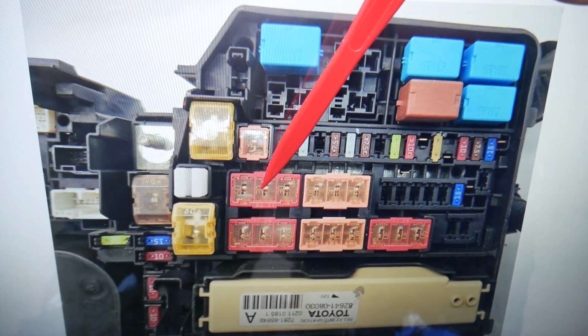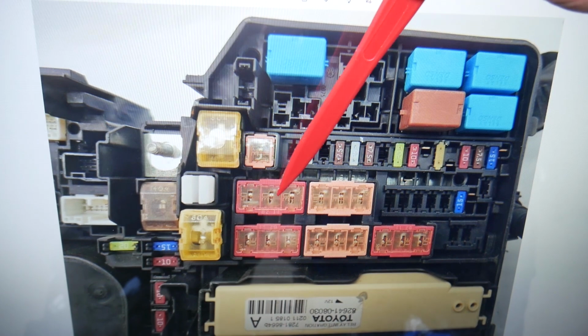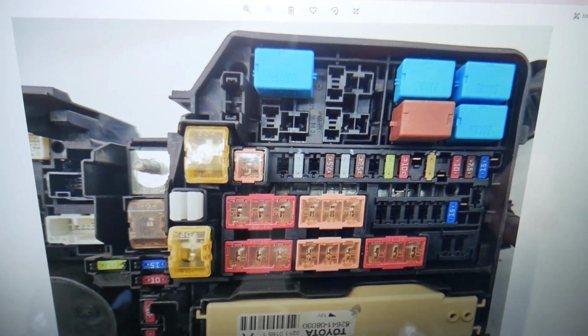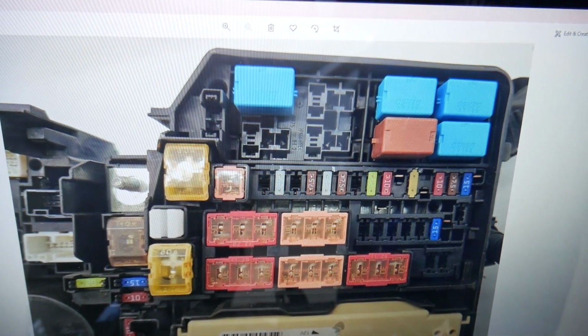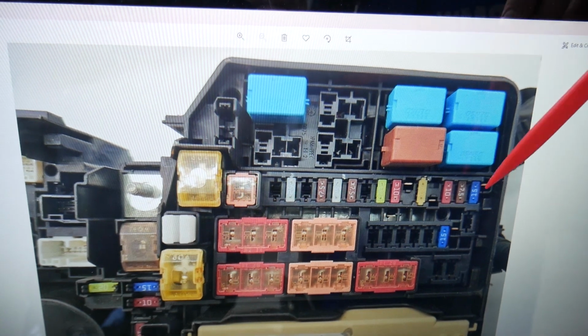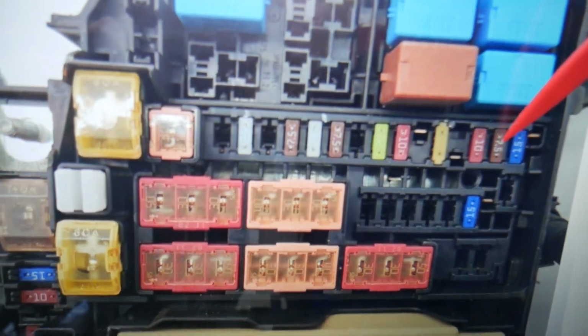Now that fuse is a triple fuse, and if just one of them burns you have to replace the whole fuse. We'll put links in the description of the video below where you can get them at a good price, with quick shipping as well. Another fuse that you will need to check is fuse number 37, that 7.5 amp fuse right here.